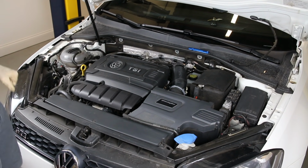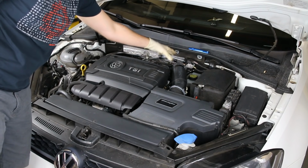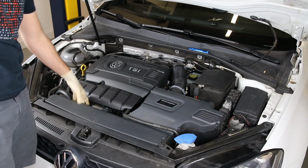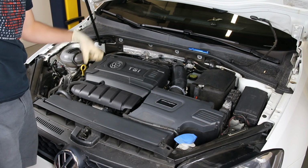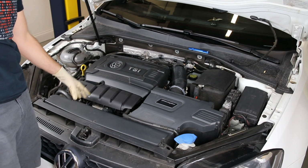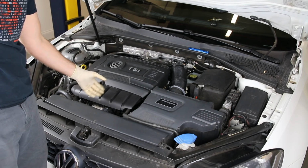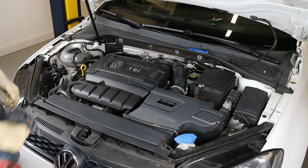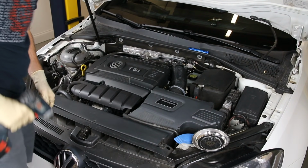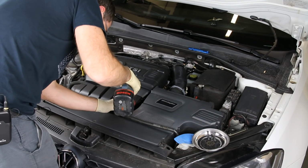Okay, so to start with removing our turbo muffler delete, the muffler delete is back here. We're going to remove our intake system here. This is an R600 intake, which we have installed. We do have a DIY video on this, so if you have a factory intake and you want to make sure that you're taking out the factory intake correctly, we will link to the install video for the R600 where you can see the removal of the factory intake there. And I'll throw our magnetic bolt tray over here so that we don't lose any of these screws along the way.